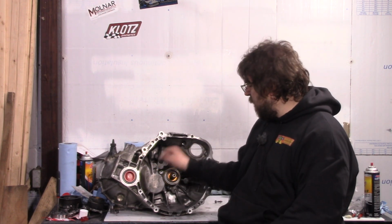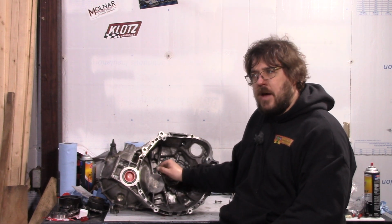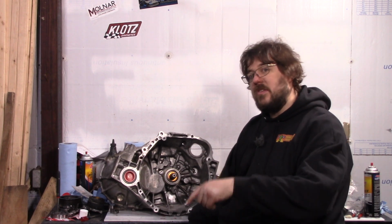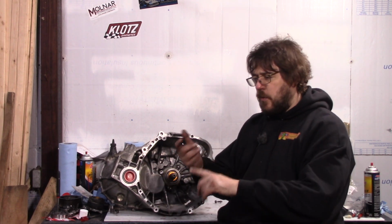We got ourselves a transmission for the Widowmaker. Yeah, well, I'm pretty happy about that. We ended up with slightly different gearing than I was expecting because we ended up using the input and the output shaft from the EB62, which is the one out of the Camry instead of the TC. Then that means that 4th, 5th, and 6th gear are all a little bit taller. Which one is better honestly depends on what you're doing with it.